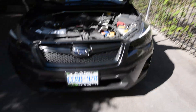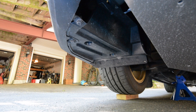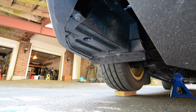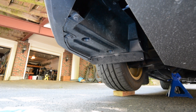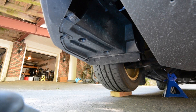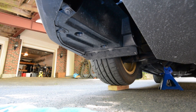Anyways, I'm going to take off the clips under the splash guard, pull up the fogs, and show you the process. I'm just under the car now — that's the portion of the under tray that you're going to need to pull off to get towards your fog lights. If you have a normal suspension Crosstrek or you're lifted, you most likely do not have to lift your car to get under here, but mine is decently low. What you're going to need is a flat head screwdriver and just a little bin so you can put your clips in.